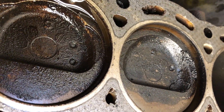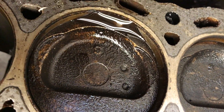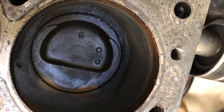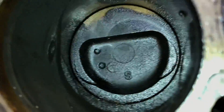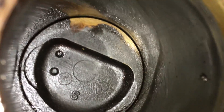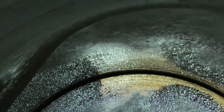Same again with the pistons — they're all very oily, got a lot of residue. There's a little bit of carbon build up, not as bad as I was expecting. You can still see factory honing marks. These cast iron bores must have a very hard surface, very hard wearing. Looks like a tiny little bit of scoring, but for an engine of this mileage it's pretty good.